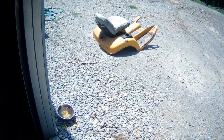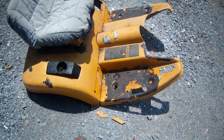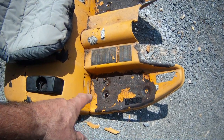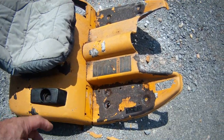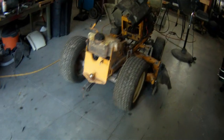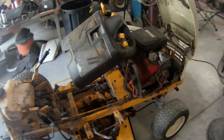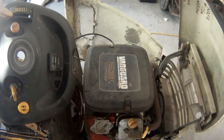Pieces all over my bench, the battery's out, you've got to take the cowl off and all your levers. I've got the body of it out here which is heavily rusted due to the wonderful powder coat they use — nothing's painted anymore, everything's got powder coat. I asked for all this metal a few days ago. Before I put it back on, I'm just going to wire brush the loose stuff off real quick and give it a quick spray bomb job and throw it back on. This thing's 20 years old. We replaced the engine back in '08 — it had a 16 horsepower Vanguard, now it's got a 23 horse.